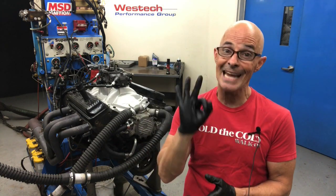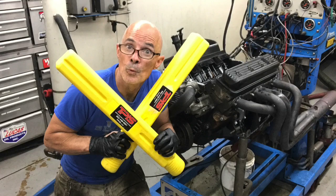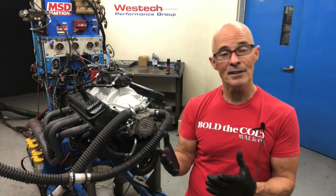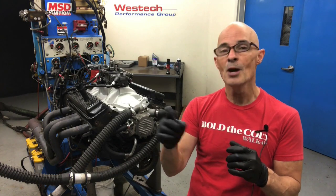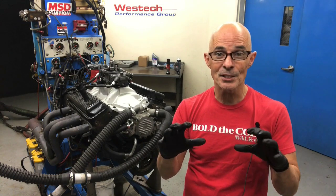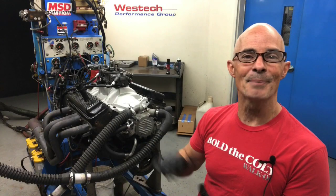In this case, we're going to take a look at camshafts. We ran it with a stock cam and then a pair of TPIS cams, both of them mild. They weren't dramatically different — they only varied by about 40 thousandths lift and about 10 degrees of duration. But there was a big change in lobe separation angle, and I think that's what we're going to point to when we take a look at the dramatic difference in the power curves. So let's start swapping cams and make some power.